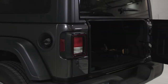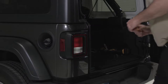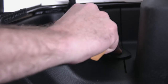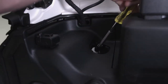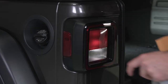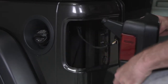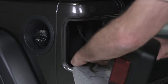To begin, you will need to access the wiring harnesses for both of the vehicle's tail lights. Locate the small square access covers on each side of the vehicle and remove them with a trim panel remover to expose the white bolts holding the tail lights in place. Use a 10mm socket to remove the bolts. Carefully pull out the tail lights. Use a shop rag to prevent the tail light from scratching the vehicle's paint.